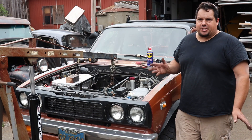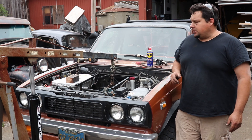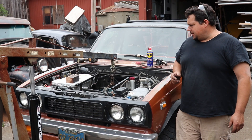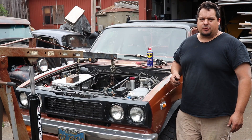One thing I have to do is take out the sway bar, because where it goes underneath the engine it would go right through the center of the oil pan. So I'm just going to ditch it — I've driven without it before on these trucks and they're fine. Anyway, that's it for these next two weeks. Thanks for watching and we'll catch up on the next one.